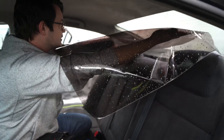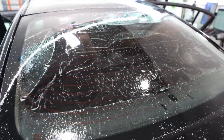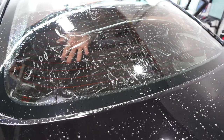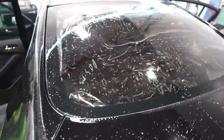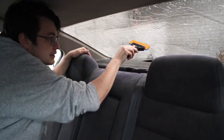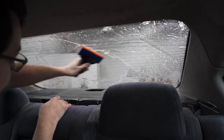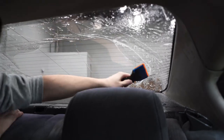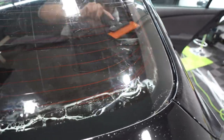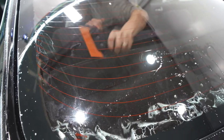Get those fingertips really close to the ends — that'll help you clear the headrest, widen your pattern out, and then put it on the glass. When you get some clearance, put more up on the glass and push it down the window to the bottom. When squeegeeing out the window, you'll notice there are a lot of little ripples. Pick a flat spot in the center, start there, work your way out — imagine you're sweeping or mopping the floor, getting all that water to go out together. Squeegee the water as far down as you can until the handle bumps into the deck.